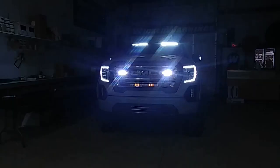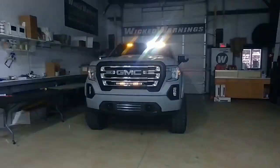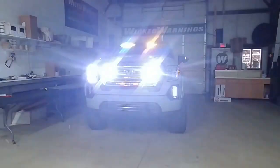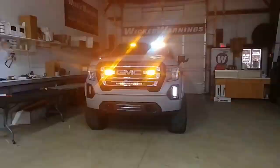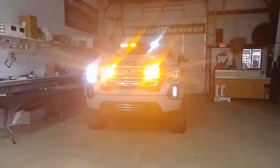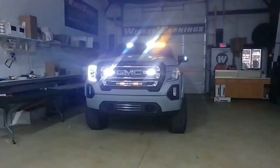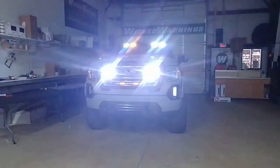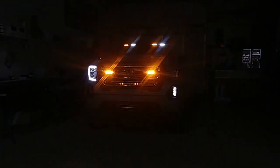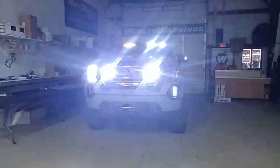All of those are tied into a flood mode. When you turn on the flood mode switch, those lights go steady white. We've got an amber and white dual visor bar in the top of the windshield — a specific mount for the 2020 trucks, custom fit to the windshield and visors. We're also running our Auto Flasher module on the mirrors, as well as the DRLs, the headlights, and the fog lights. The Razers are synchronized to flash together in amber-white. I'll darken the ISO so you can get an idea of what the lights actually look like in person.